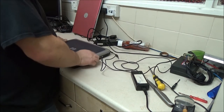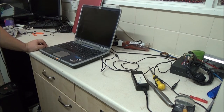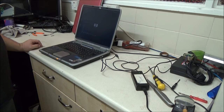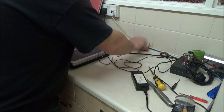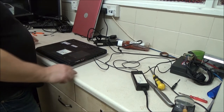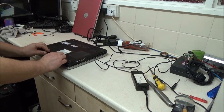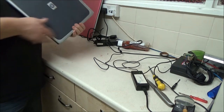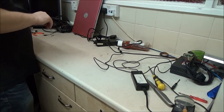Another HP here — we might have done this one in a previous video. It's funny how that exact same screen comes up on the Compaq. We're missing a hard drive, or the hard drive is dead — because I can actually hear something clicking. Just because it's not detecting the hard drive doesn't necessarily mean it's the hard drive that's at fault, could easily be something else.